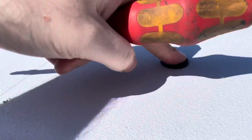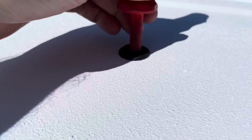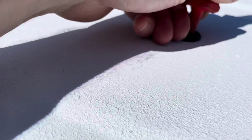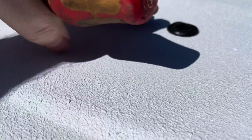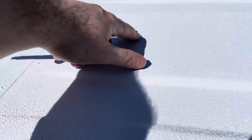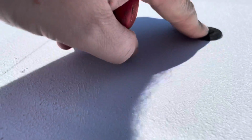Before I put my cables through the hole, I've just put a rubber grommet through, so this is the type that goes through and then sits both sides of the roof. And a little tip, if you pop a little screwdriver in here and just gently manipulate it around, you'll make sure that it's well seated. It saves your fingers as well, and then you can see that's given you the correct internal diameter now to be able to get that cable through. We're only putting a cable through here, so that'll be plenty, but it'll just stop it getting snagged. And then the gland's going to go over the top of there, so this will provide a little bit of extra waterproofing as well should the gland fail, which it shouldn't. But the gland's actually going to go around this anyway.